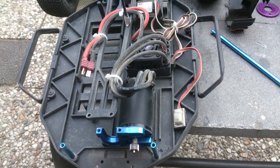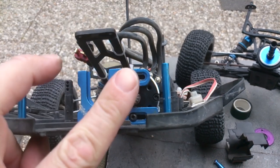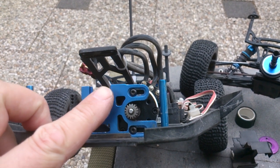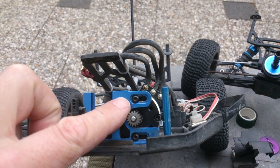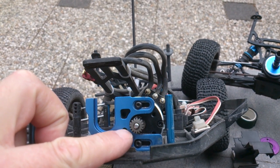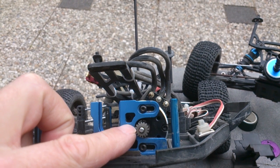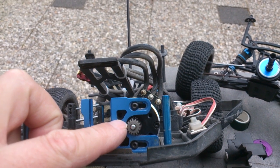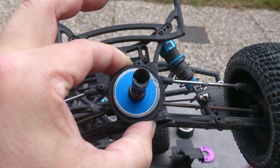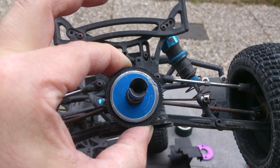The motor itself is actually pretty good, but there's a problem. The screws are almost in the entire left position and really can't go any further. This is a 48 pitch gear. The default that comes with the ready-to-run is module 0.6 — that sounds like great fun but it isn't, because the module 0.6 gear you get with this vehicle isn't round. So even with the brushed motor I had, I stripped that gear in the first battery pack.